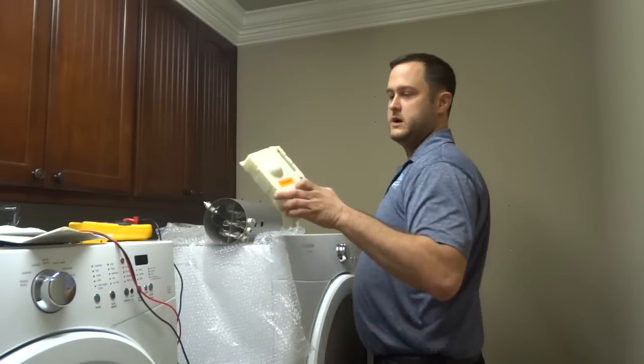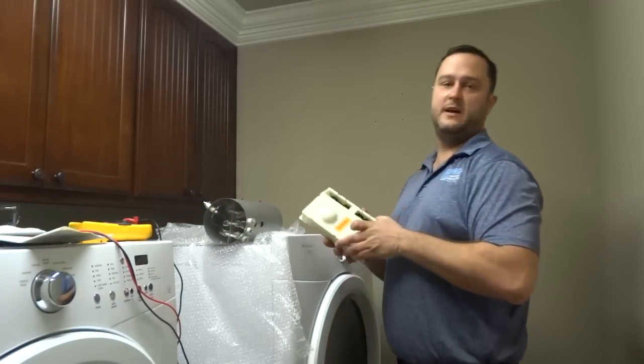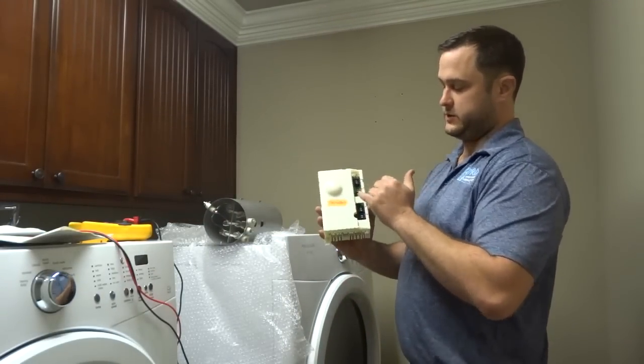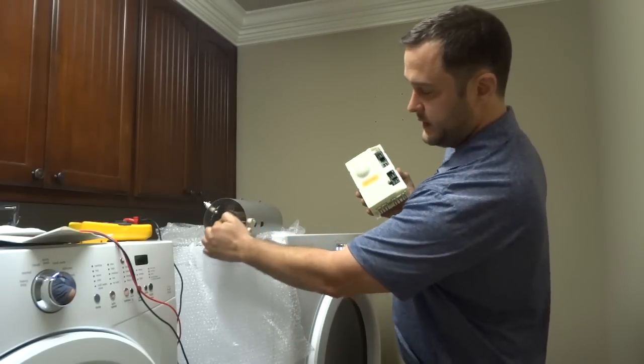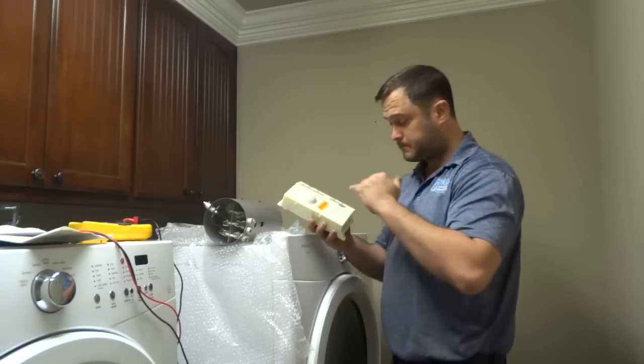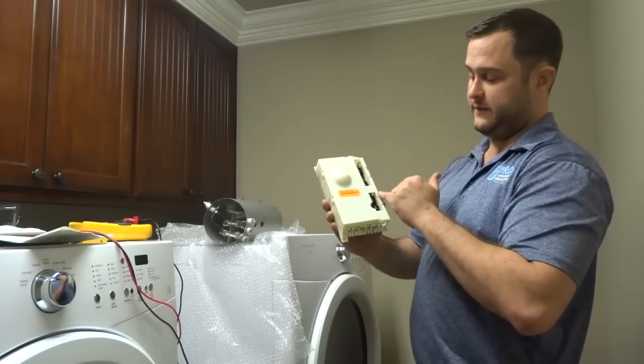And so, starting with E61, you're looking at heater relay failure typically. There are little black boxes in here that act as relays for the three different heating elements and coils that are inside this heating element. The way you test this, what it's looking for is if they're shorted or if they're open.